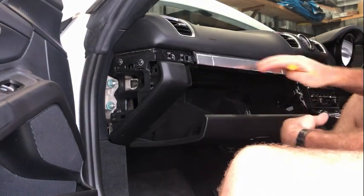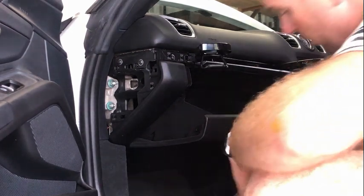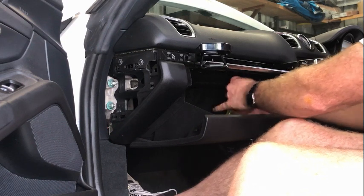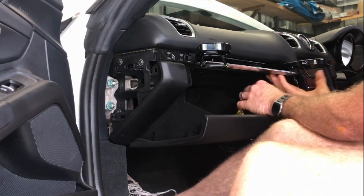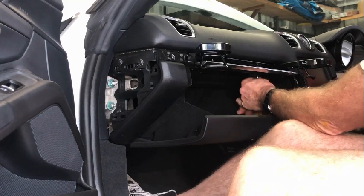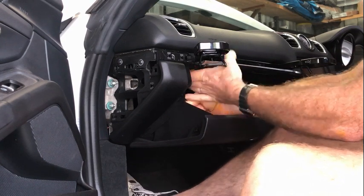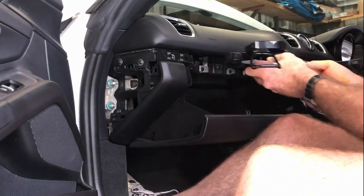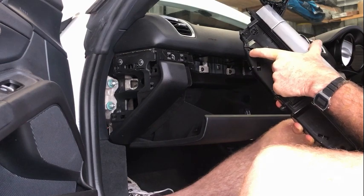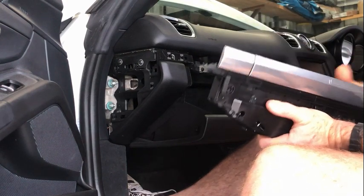The next one is the drink holder. Open those up, get yourself a screwdriver, and there's two holes at the back, but there's the one sort of that's closest to the pivot. You're going to push up, there's actually a little clip in there, and you're going to push it up, you'll feel it's a little spring, and then pull it out. There's one on both sides. And that just pops straight out. The actual holes that you're pushing it up through, that one there, and the spring little things are up in here. Then you can close that up and put that away.